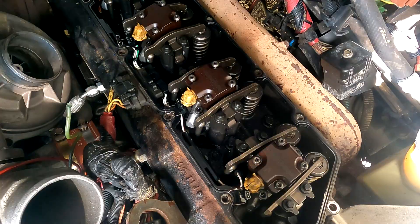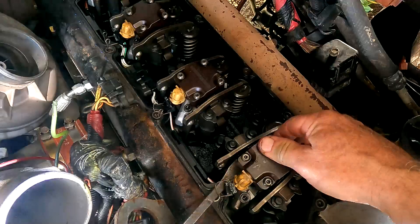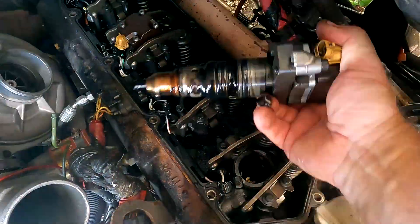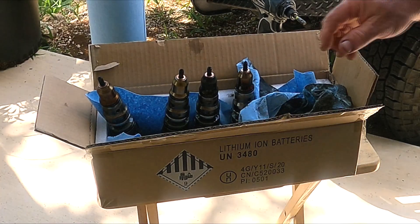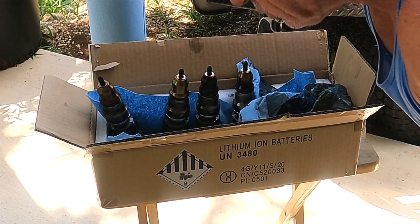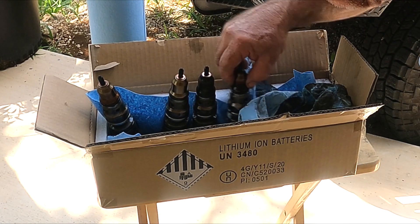There are a lot of videos on YouTube about pulling injectors. I'm just gonna time-lapse this. Basically you just undo that one little bolt on the bottom side. I don't take the oil vents off like some videos say to do — I still don't want to mess with it. As long as you pry underneath the metal piece, not the actual vent, you'll be fine. Get them out and take a look. Here are the four injectors — the one on the left is number one, the one on the right is the fourth one on the passenger side.